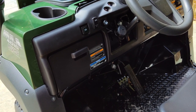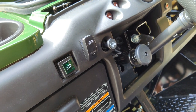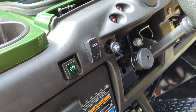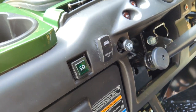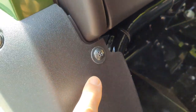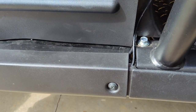Now I'm looking on the left side of the interior of the dash. That's where I ended up mounting the toggle switch. What worked out great about that is if you look real close before you mount it in there, there's an etched-out rectangle on the dash itself for you to make a cutout. So what I did was go in there with a box cutter and use that to cut out the rectangle, and then this switch drops right in. I ran my wiring down in there, and then to keep it hidden, I just disconnected all those pieces there with the screws and ran the wiring harness underneath those up against the bar underneath.